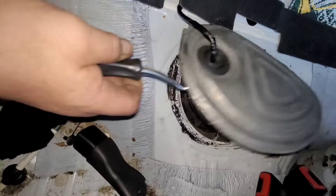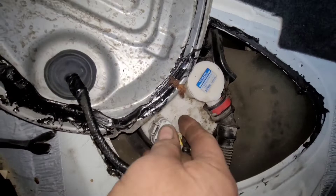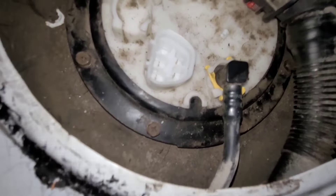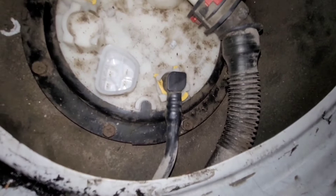We're holding this out and here's the connector. The upper locking piece is actually broken. You squeeze the tab right there and release it — I may have to do this two-handed. I finally got it to release; it took a little effort. Now I've got to disconnect the three fuel lines: the top one is a vapor line, one is a pressure line, and one is probably a return line or another vent-type line.